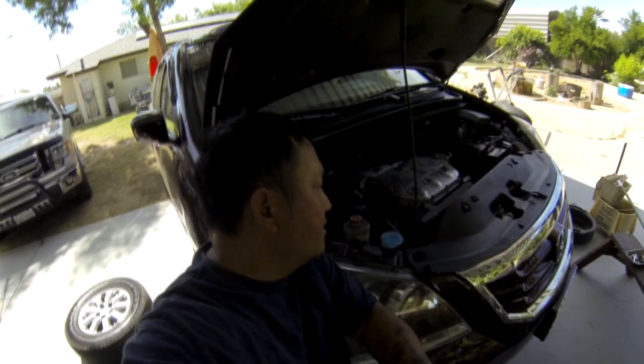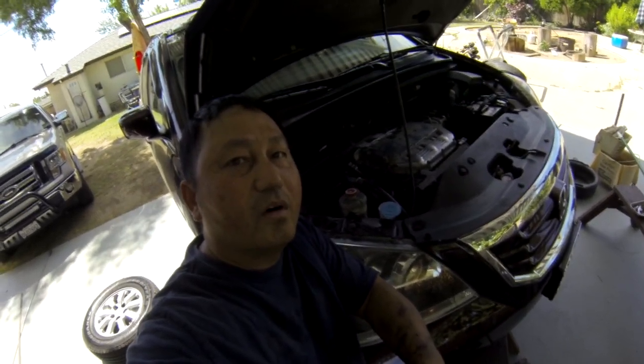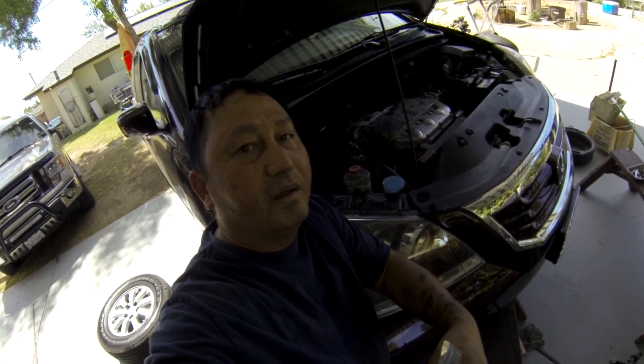Okay. All right, thank you for watching. So now you know that your car is not a burnt cam or crank. It's just the tensioner that doesn't work, so that's why it's tapping like that.